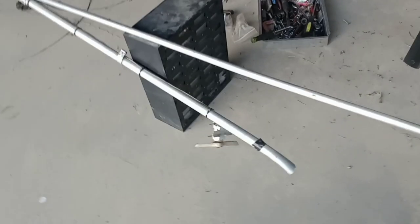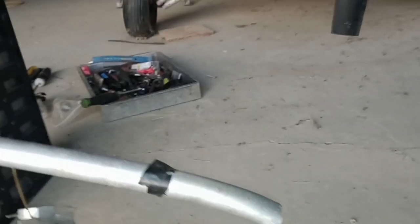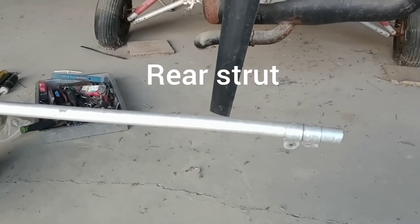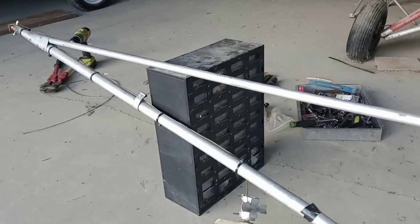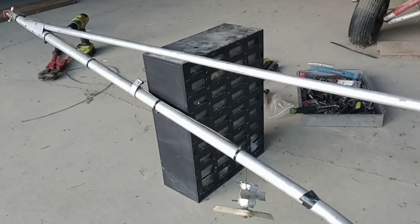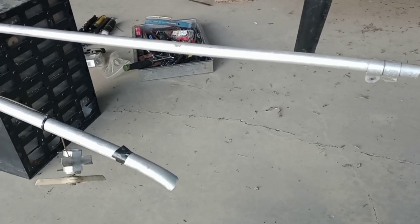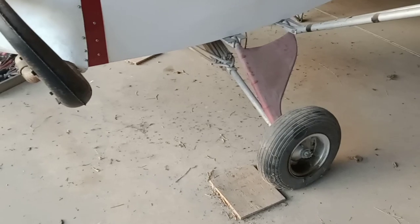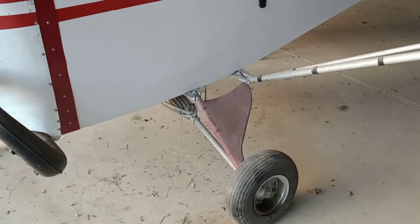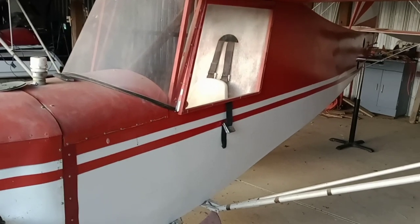The field was lined with arborvitae bushes, and this main strut — which you can see is very large and heavy — sheared right off, ripped right off. But that wing kept on flying, just hanging on the rear spar. It shattered a lot of the geodetic in the wing, but that wing was solid enough we used it to limp the plane onto the trailer, lifting the plane just with that rear spar. Anyway, that piece isn't quite long enough for both uprights I need, so I'll have to check at home. Then I'm going to get the bungees all secured up on the landing gear, and at that time I'll probably do a weight and balance, do another thorough inspection, and try to get the engine running. He says it should start right up, but he hasn't started it in several years.